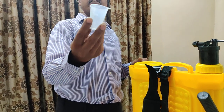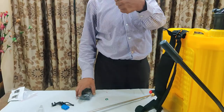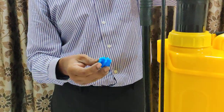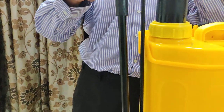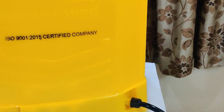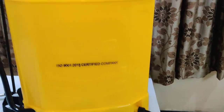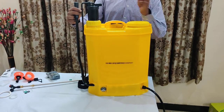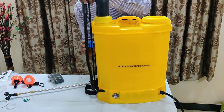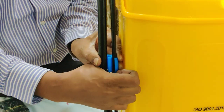This can be positioned like this so that the person can hang it on the back. The total weight will be only 15 kg, so it won't be difficult. Just after installing, check that you have installed it tightly. This is one measurement glass — for example if you are putting some Lysol, Dettol, phenol, or any disinfectant solution inside with mixing water. This is a rubber bush which will be used to hold these two rods so that they will not shake when using the sprayer in manual mode.